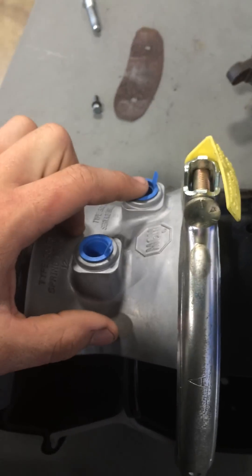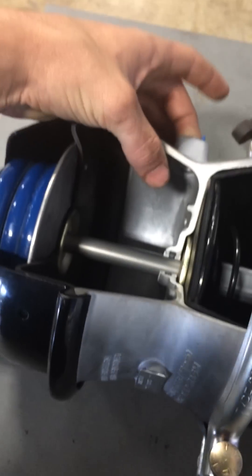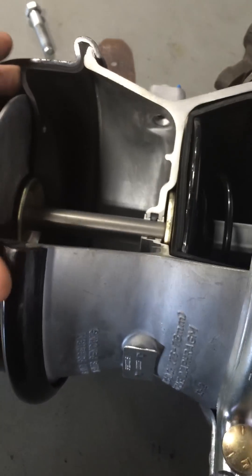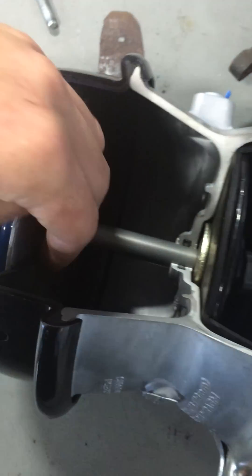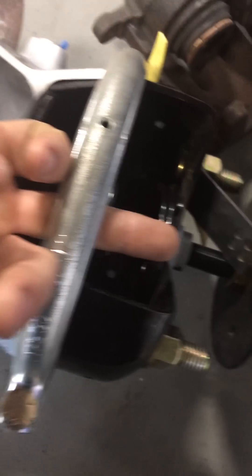This is your parking inlet, this is your service inlet. So when you go in your parking inlet and you push air pressure without this on, this will be all the way forward. What happens is this right here gets air, it fills this chamber up, it fills this bladder up right here so it's sealed, and it slides this back. And when that slides back, it pulls the tension off of this that it's pressed all the way forward.